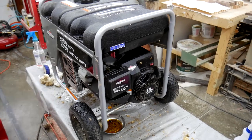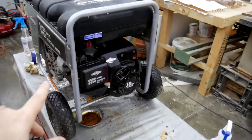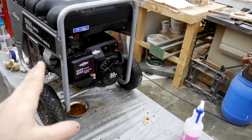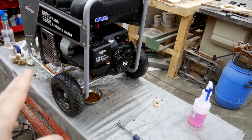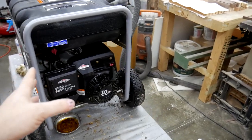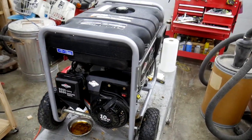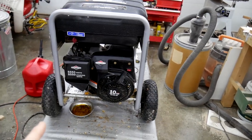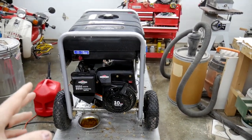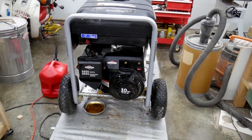I realize this video was somewhat anticlimactic because it was just a dirty carburetor issue, but I can tell you when it comes to small engines, nine times out of ten that's the issue — a carburetor issue. And that other one out of ten is usually some type of a fuel system issue if it's not the carburetor. This is good for people who understand how carburetors work because most people will just end up not being able to start their small lawn equipment and just throw it out thinking it's bad. Usually with just a little bit of disassembly and cleaning you can get things up and running again. I hope you guys enjoyed the video — go ahead and leave a like, subscribe to my channel, leave a comment if you feel so inclined, and I hope you guys are staying safe out there. I'll see you next time.